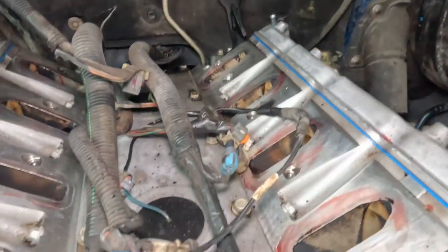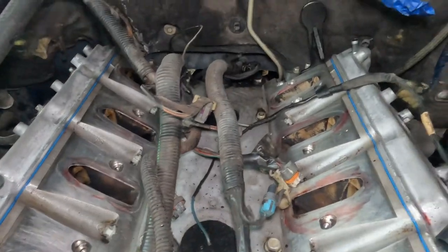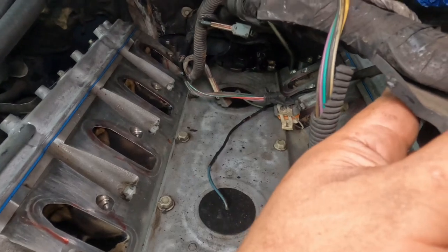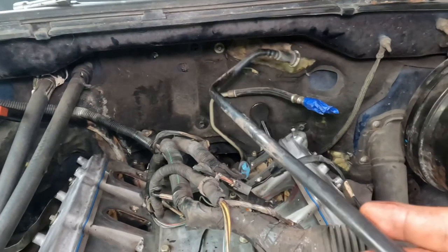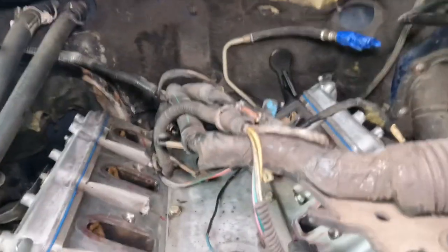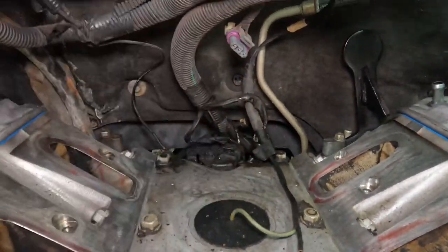When we put this on, make sure you lift up all these things. Remember, this is your knock sensor. Make sure it goes underneath it somehow. Make sure no wires get pinched. Take your time, lift up everything and pull it under. I'm trying to get a short on how I do it. Do y'all remember that line in the beginning that I was having trouble with? I took it off from the back, so I'll put it on after. It's just a little plastic clip. Let's go ahead and put this on. Okay, this is how I'm going to route my knock sensor. I'm going to put it behind that wiring harness, so it doesn't go to the sides and get pinched. I'll make it run all the way to the back and come up.